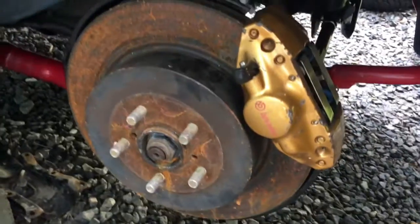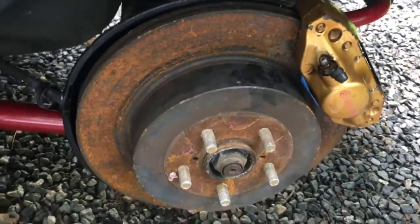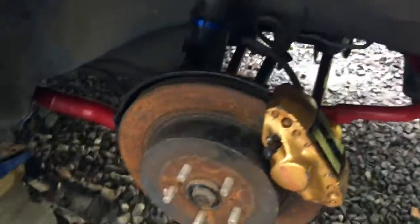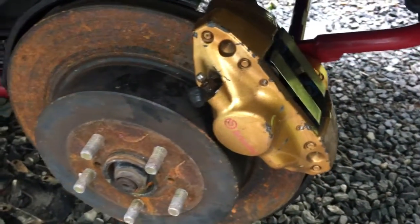So you get the rear diff, you get the axles. The axles just slide right into the trans there, and then they slide right into this hub. And this is, again, the STI rear hub and knuckle and everything. Everything bolts right up just like it would on the stock WRX. This does mean you have to go with, of course, bigger brakes and calipers, the Brembo calipers. I do believe the 2-pot upgraded WRX brakes would work too, but anyway.